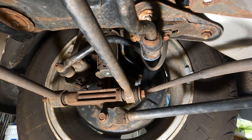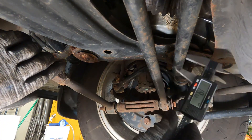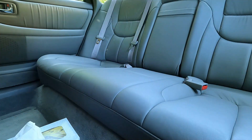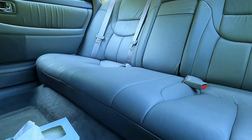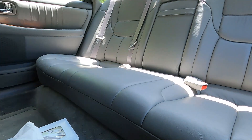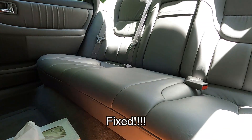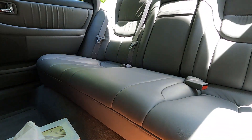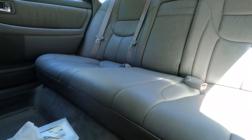That'll be great if that solves it — that was all too easy and just took a couple minutes per side. So I think we're good for a little test drive. I was interested about that 17 marking on here, and sure enough these appear to be a 17 millimeter sway bar. It is fixed — absolutely no rattle. Those rear sway bar bushings took care of it. Now that it's fixed, let's change parts on the front because we can.